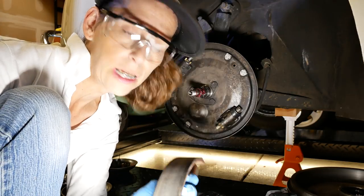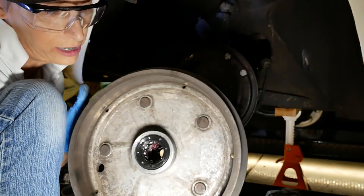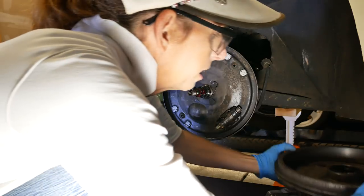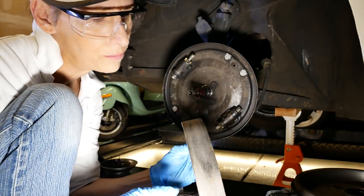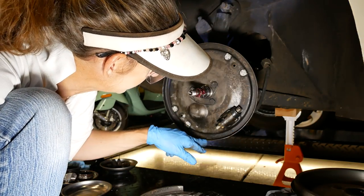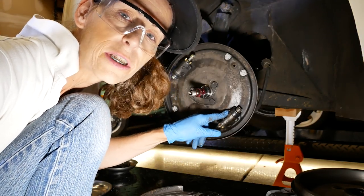It's pretty important at this point to just double check our pads and check the inside of the drum. It all looks nice and dry inside here - I don't see any wetness on this bit or against the drum itself. The pads look good as well, nice and dry. That's a really good sign, so I think our leak has just been piddling down and accumulating here. I imagine it's this cylinder, so let's pull it apart and see what's going on.